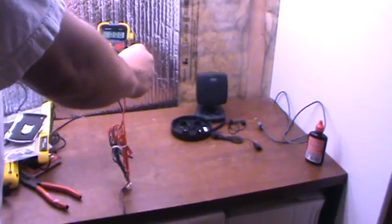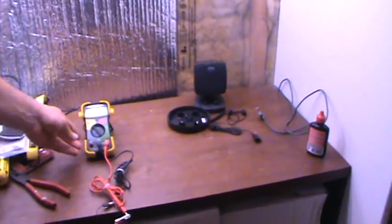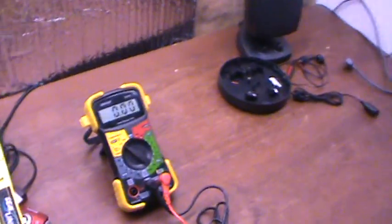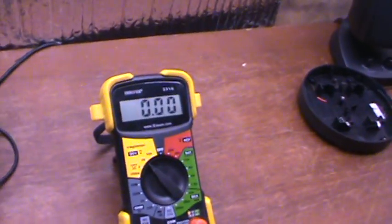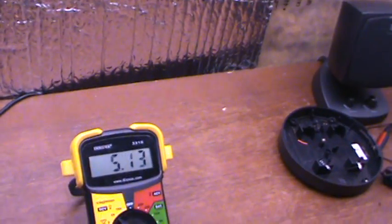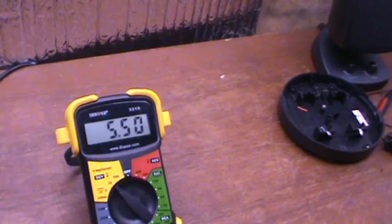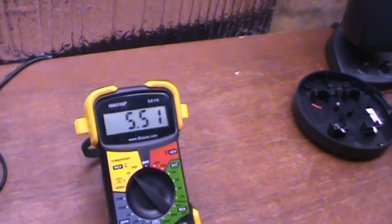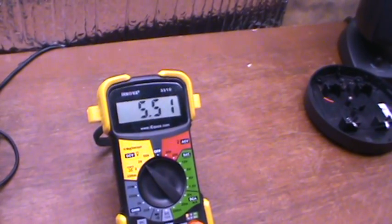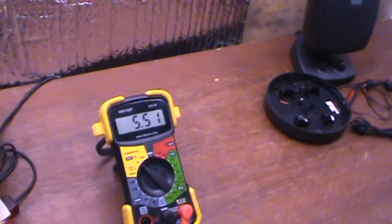When we take a look at the readings we get — let me get to my voltage, and if my cameraman's going to just keep an eye on that — you'll be able to see that at a regular pace, because of the regulator, I'm able to get the desired 5.5 volts, and I'm not overcharging. And if I crank it up even more, it doesn't move. So that's the good thing about the voltage regulator.